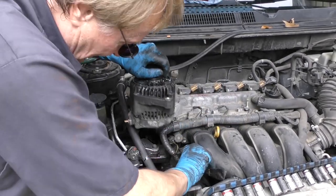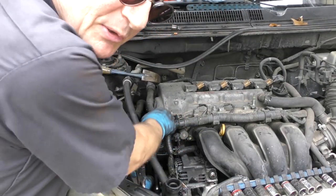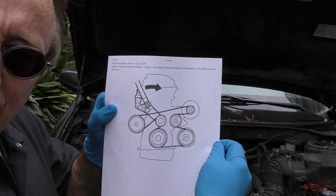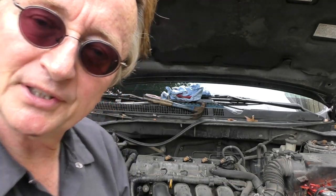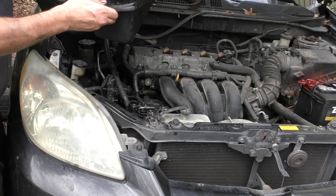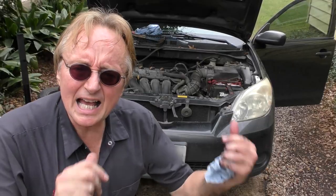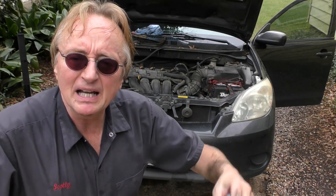Try and slip the alternator back on — not much room, but doable, especially with gravity. Then tighten the 14mm bolt on the bottom of the alternator and the 12mm bolt on the top. Then you have to put the drive belt — or fan belt, whatever you want to call it — back on. I printed out a picture of where it went ahead of time. If you don't have that, take a picture before you take it apart so you'll know exactly where it goes. Pull on the tightener, slip the belt on, and there she goes. Plug the alternator back in, bolt it back on, and snap the charging wire on. Then fill it up with the old coolant you saved. Notice this coolant had a little sealer in it — somebody added sealer at some point, so leave the sealer in. The sealer's probably sealing things you don't want leaking again. Start it up, let it warm up for about half an hour, and keep adding coolant until it's to the top to get the air out. So the next time your car starts leaking coolant, now you know how to check for the leak and how to fix it — even if it's something as hard to find as a water pump that only leaks when the car is running.